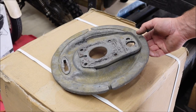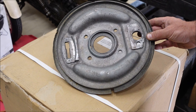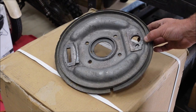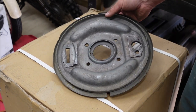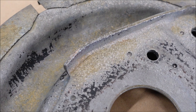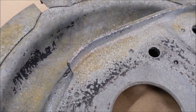This is the way to go on the smaller parts. It certainly did an awesome job cleaning it up, and I was very concerned about drying it as quickly as possible to avoid flash rusting, which you're gonna get some, but it's not bad at all. For the smaller parts, I'm gonna avoid using the slag remover because it puts a bunch of little pits in it. I don't mind on a frame, but this, I don't like so much.